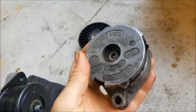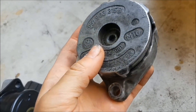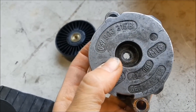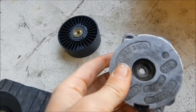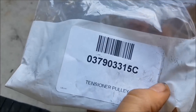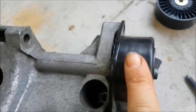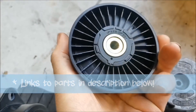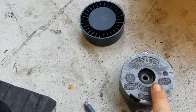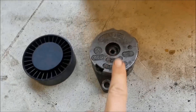This is not technically part of the timing belt job, but when I take the time out of my crazy life to do something like this, I like to go ahead and replace everything. This is actually totally fine — it's a little warm but still doing a good job. However, I made a huge order. Here's the part number — a new one. This is the tensioner side, this is the pulley side, and I've got a new pulley too since my old one was quite shot. This I did need to replace; this I didn't, but I'm going to keep it as a spare since I plan on driving this precious car forever. I save everything.